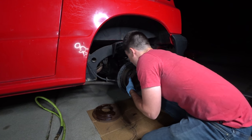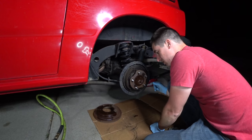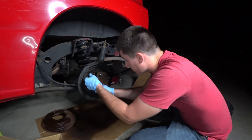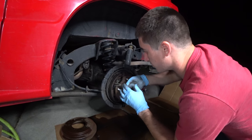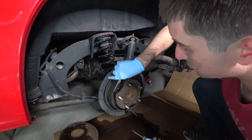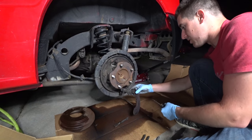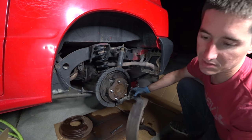We are going to replace every bit of this. Looks like we can actually turn this to access everything in here, but let's take a couple pictures first, make sure we know what springs go where, and then start replacing each little piece. Drum is off. Now we can pull this upper spring that holds the pads together — spring is out. Pull the lower spring. I plan on replacing every bit of hardware in here as well, but unfortunately I ordered it from O'Reilly's and it never came in. You can tell there's not a lot of friction material left on these — they are basically to the metal. So I'm thrilled to have some new drums in the back.